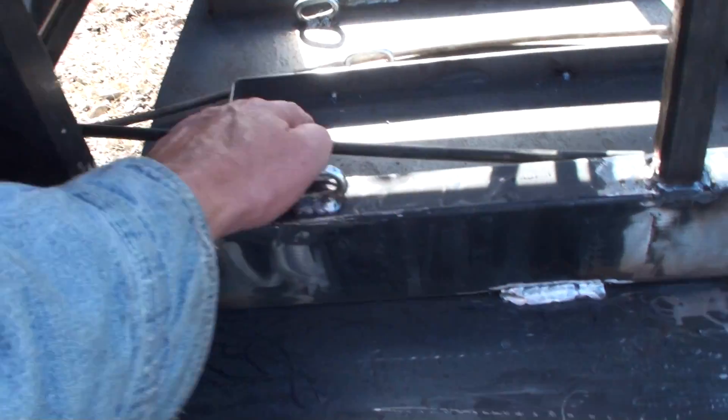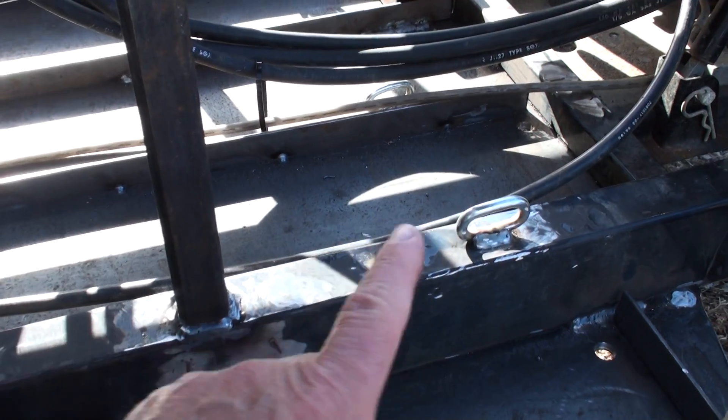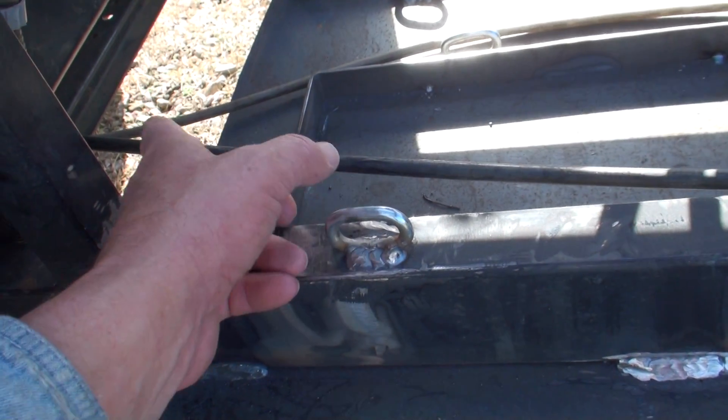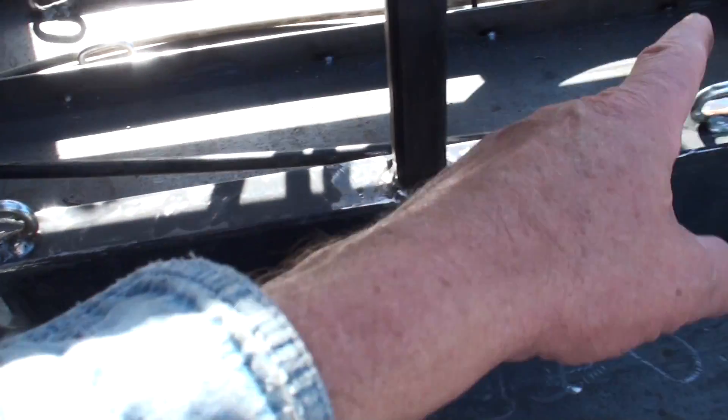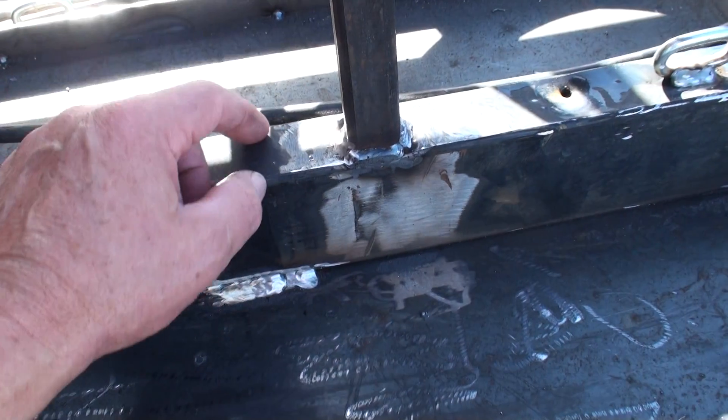You had to have a little space here to clear this battery right here in the front. So I cleared that, and then the brake line had to — there's a little clip up here in the front — I had to cut so I could reroute the brake line and put it on the other side of the battery. Originally it was way over here, so now it's over there.